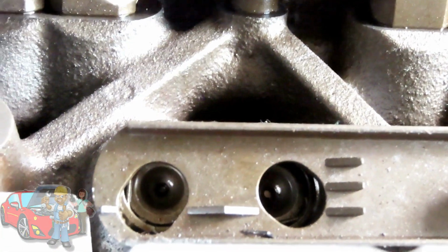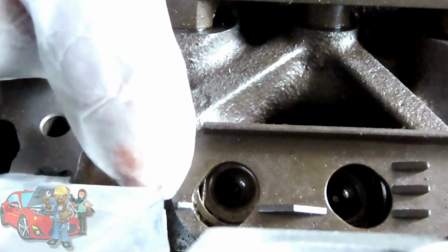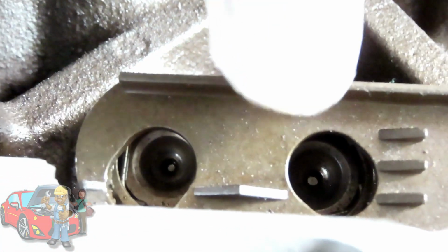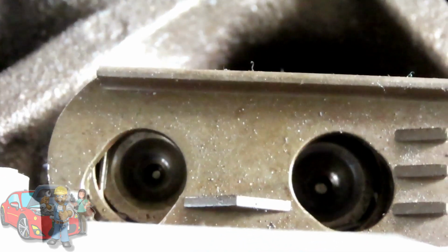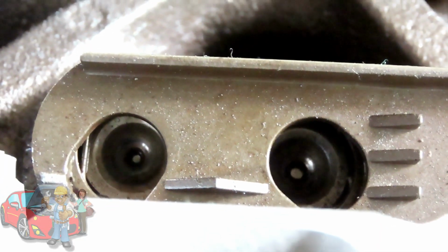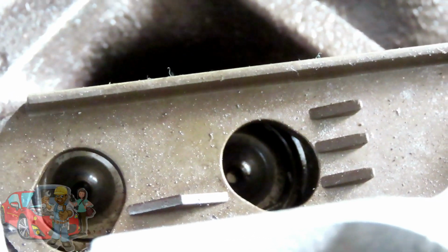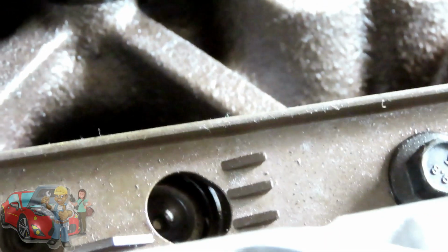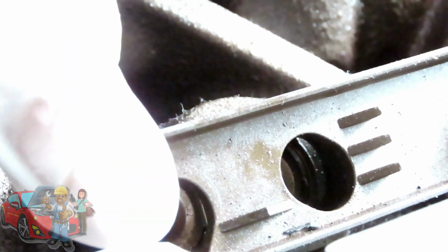They look the same. Am I looking at it wrong? Inside is the lifter, and you'll see a little metal piece in there, how it's all the way up. And matter of fact, look at this hole right here; you can tell that one is down further. Okay, maybe it's the angle or something. They look the same. Yeah, okay, look right around here, at an angle. You have to look at the side of it. If you need a light, let me know. Because if you look at the side, then you can see. I see it. You can see how this one's further up and that one's down.